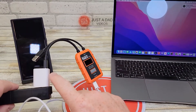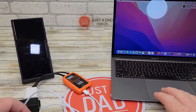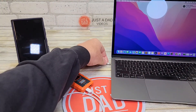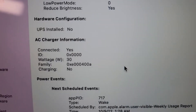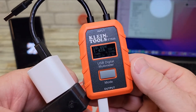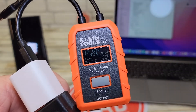Another nice feature of this charger is being able to put 30 watts of charging power into a MacBook Air or a MacBook Pro. So here I've got a MacBook Air — let's plug it in and see it charge. We can see in the MacBook Air it's charging at 30 watts, with power going to the MacBook Air at 19.89 volts at 1.42 amps.